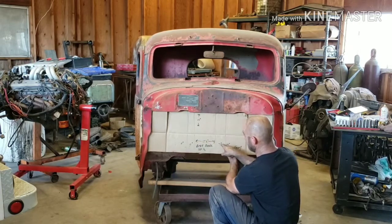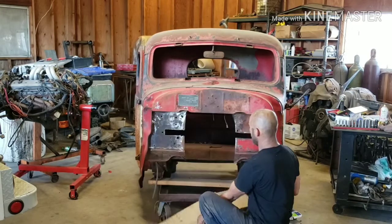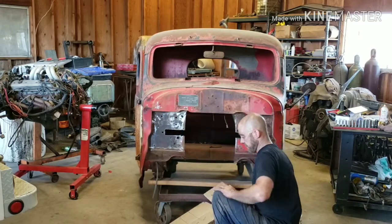It went in three inches, so we had to add seven inches at each break. And then we're going to set that box-in piece of steel right here — we'll tag it, and then we'll set it on the frame.